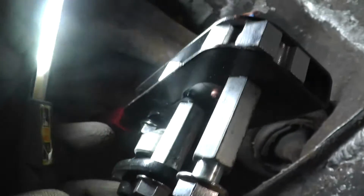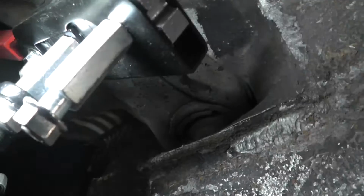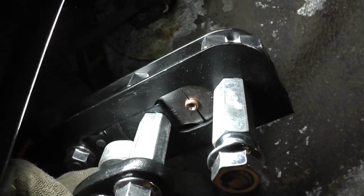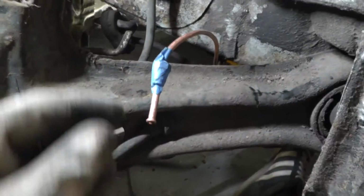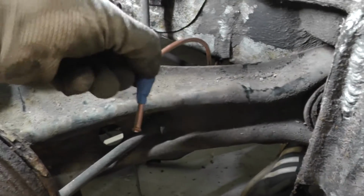And then to get the flare you need for this Honda system, you need to press this cone into that flare to get the double flare in there, you can see. It's worked out quite nicely. Then I can just remove this tool and then bolt it up. This is why I've taped this thing in place. I can just remove this tape now.